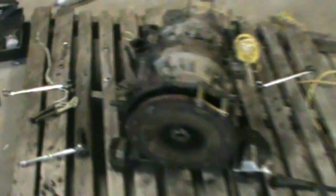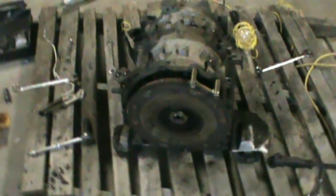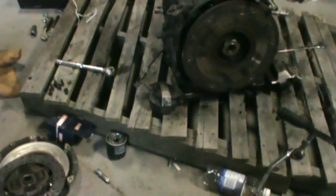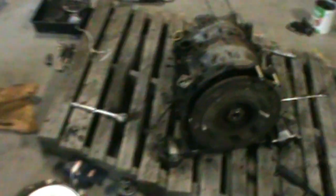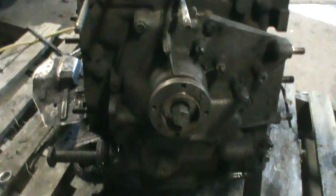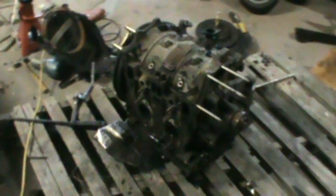I'm going to have to wait until tomorrow to get the flywheel and stuff off because I need some helpers to hold the motor — it's torqued on like 200 or 300 foot-pounds and I can't hold it myself while cranking. I'll wait until they come over and also take off the oil pan and engine mounts to give us a bit more leverage. I just have to pop off the flywheel, oil pan, engine mounts, break the front hub loose, then take off the front cover, oil pump, oil chain, and then it's ready to be torn down. Thanks for watching and I'll check back tomorrow with the teardown video.